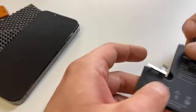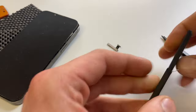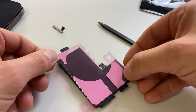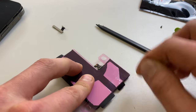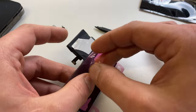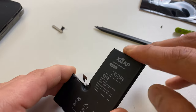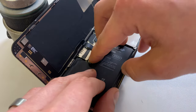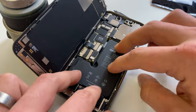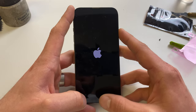One final step — because I like to reuse these battery flexes, disconnect it from the power again, disconnect the battery from the logic board, take out the battery, disconnect the Tag-On Flex, and then this battery can be installed as normal. This is going to be the last time I take this battery out, so we're going to stick it down with the battery adhesive that comes inside the packet. Applying some pressure means they stick much better. Peel off the back, fold over the tabs so that someone has a chance of getting it out if they ever need to remove this battery again. The best way to ensure perfect alignment is to connect the battery first before you push the battery down.